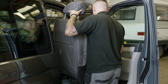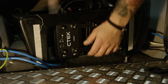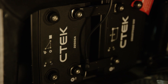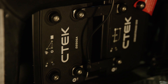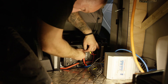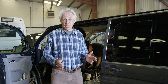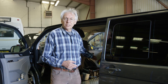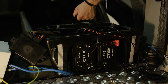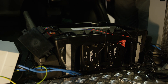These two products build a 140-amp charging system that quickly charges your leisure battery and distributes 12-volt power safely and reliably. In fact, when you combine them, there's nothing else like it on the market. To ensure maximum performance and reliability, it's important they have adequate ventilation and are mounted near the leisure battery — as close as possible. That's why Damien has installed them right there underneath the driver's seat, right next to the leisure battery.